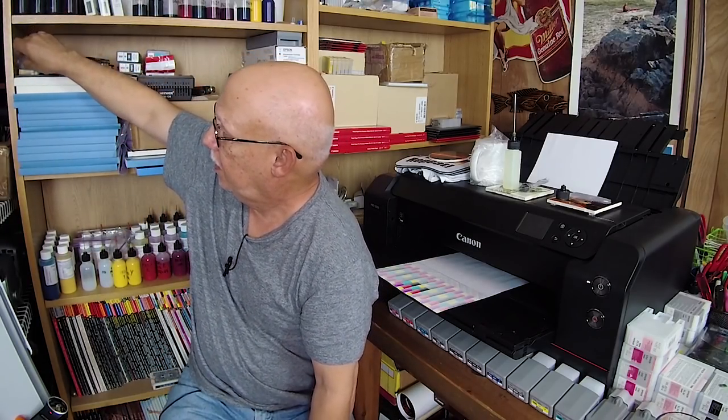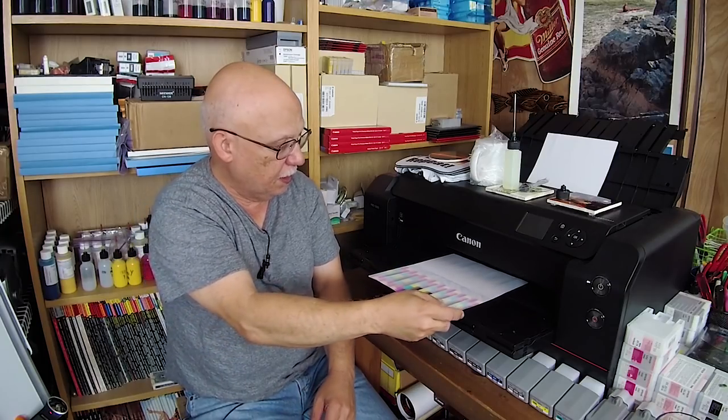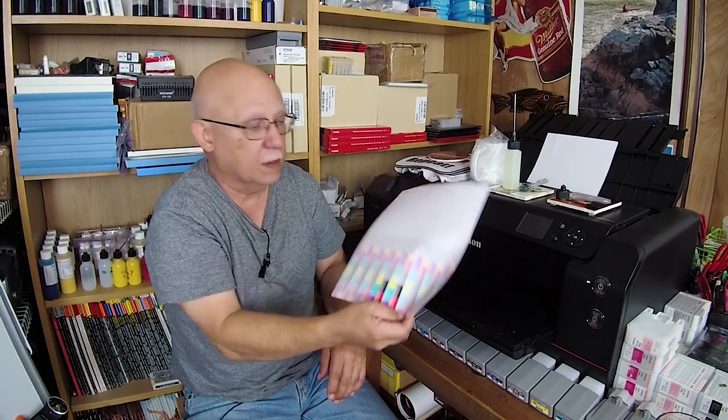Let's go ahead and plug this back up. I've been printing these perch sheets on this baby, and every two days, no cleaning cycles. But I bet after 60 hours, bingo — cleaning cycle. So that's the way these printers work. To reiterate: with the Pro 100, it's 120 hours or 480 hours plus a minute and it will trigger a cleaning cycle, then the counter starts again. Nothing to do with printing or the frequency of printing — it's timed.